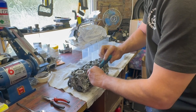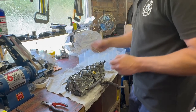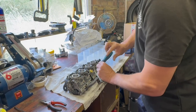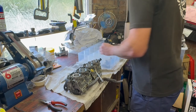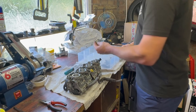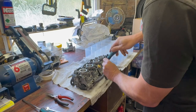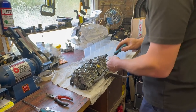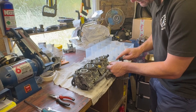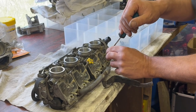This is why you have to have a decent set of screwdrivers that fit well, because they're brass parts. If you start with a badly fitting screwdriver you can easily gouge the jets, and then if you gouge the jets you're going to be in a world of pain trying to get them out. Do it properly — and you can see on these jets just how much rubbish is sat on the top of them. It's horrible, they're all going to be furred up.